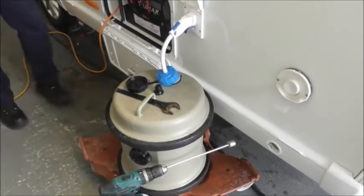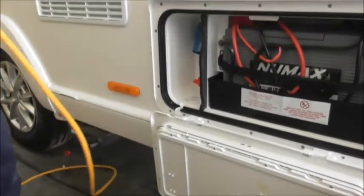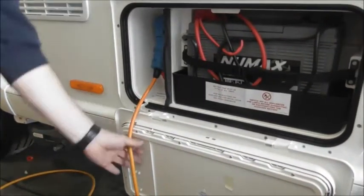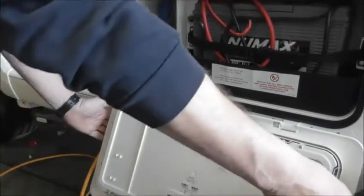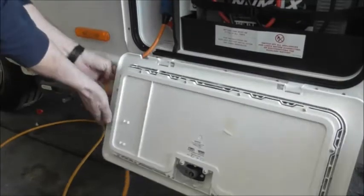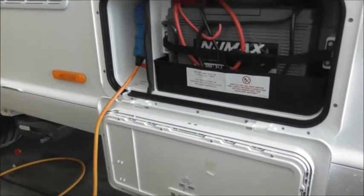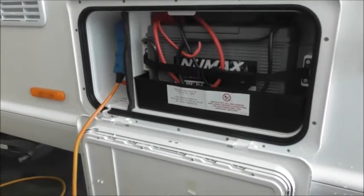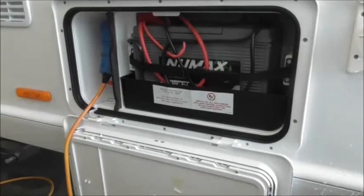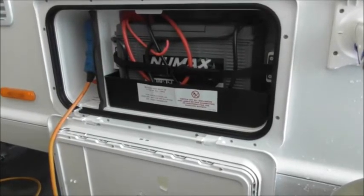The next thing to connect is your electric. Pull back on the cable connector, and connect to your caravan first — push it all the way on, find the little groove, push it across, and lock it up. Unravel the cable fully, then connect to the bollard last. Don't connect to the bollard first because then you'd have a live cable while walking across wet grass — not going to be good. When it's time to go home, disconnect from the bollard first, then from the caravan last.